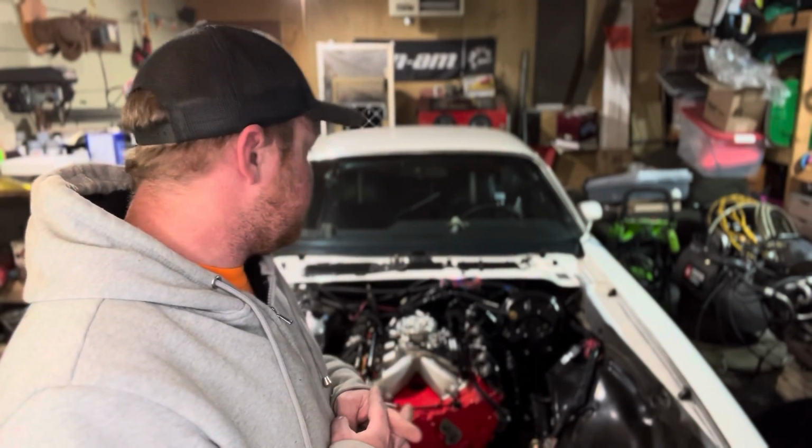I went ahead and purchased, let me get the part number, a throttle body cable bracket from Holley. If you guys want to know, it's a 20-112. That works with this intake, with this throttle body, with the fuel rails. I actually went up to a local store and that was one of the parts that I really wanted to look at before I purchased it and take some measurements off of it, because it's kind of a guess if it fits or not. So it does work with this setup. So if you guys are interested in it, that bracket does work with this setup. So I'm gonna insert the footage here of me installing it.